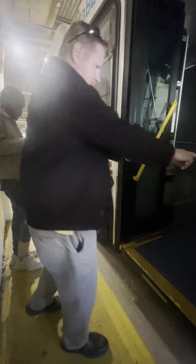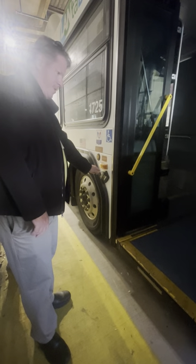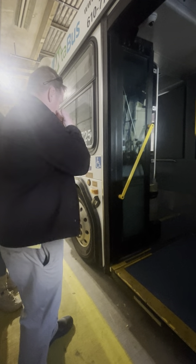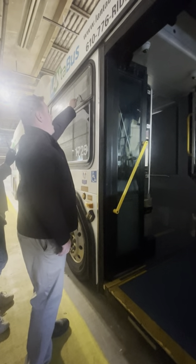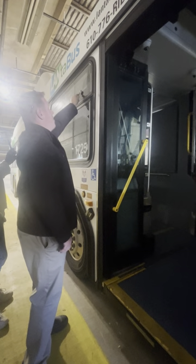Three entry lights — one inside, two outside — clear in color, not cracked, not broken, no moisture present. All windows down the passenger side: not cracked, not broken, clean, no illegal stickers. All weather seals around the windows are not cracked or dry rotted. Side destination sign — not cracked, not broken, properly mounted and secure, no moisture present.